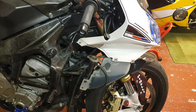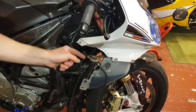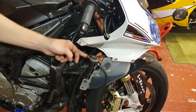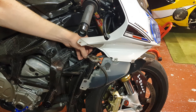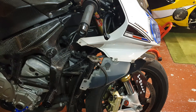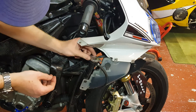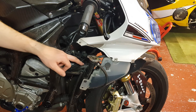Because the clutch cable is rubbing on this I'll just wrap it with some electrical tape, just to make sure — the lock wire will be fine, it'll be the rubber on the clutch cable sheath that'll get worn through. Now it's just a case of tidying that end off, give that a good clip, push that over that way — that should look right. Job done, put your fairing back on and don't forget to plug your indicator in.